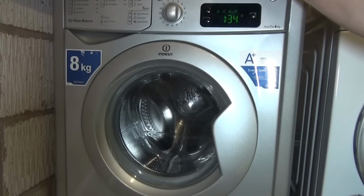And then an energy saver is actually what is also known as eco wash on Hotpoints, or eco time in the past. No, sorry. Eco wash on Hotpoints. That basically just turns off the heater. You should wash according to the instruction manual, but on this energy saver for cotton, it's usually around 3.5 kilos as opposed to 8, and then for synthetics, instead of 3.5 kilos, it's normally about 2-ish.